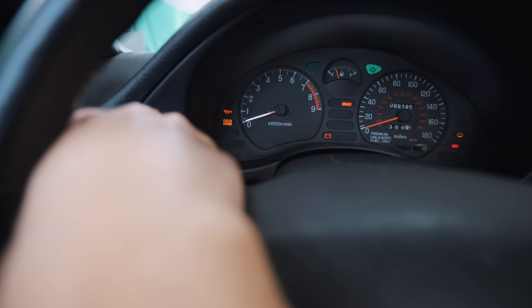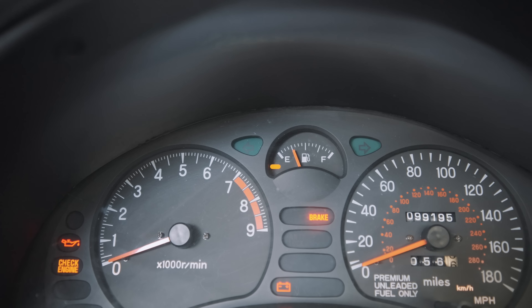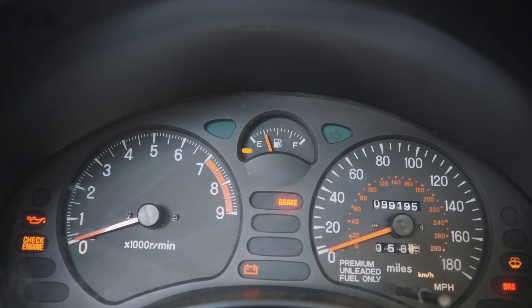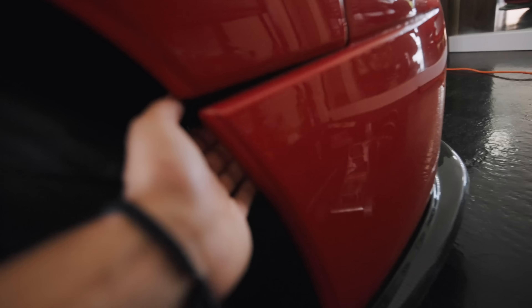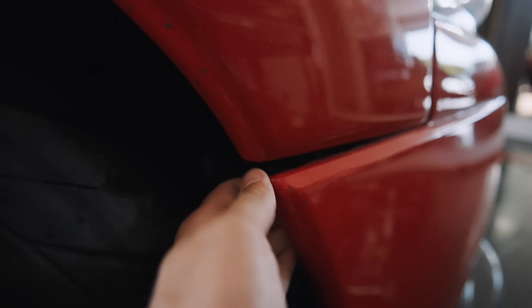When I go to the right, it makes a really weird sound. And as you guys can see on the gas gauge, my gas light turns on right at a quarter tank and does not go any lower than that. So we are going to be inspecting the fuel pump in the back to make sure everything's properly seated. I also noticed we're missing the 10mm bolt holding the bumper on to the fender, so we'll be adding one of those.